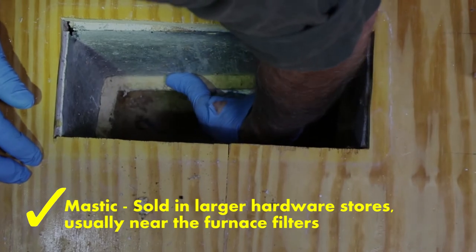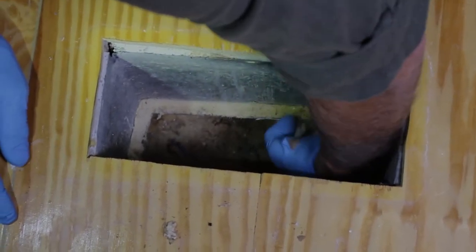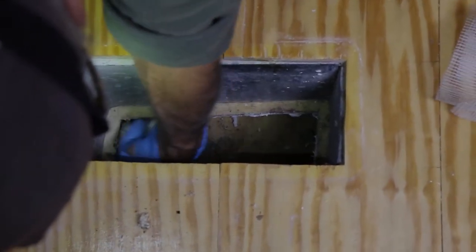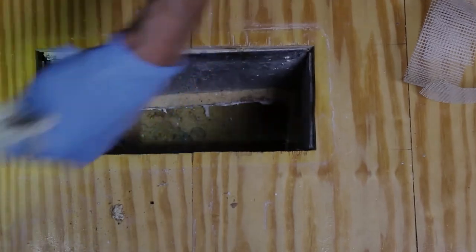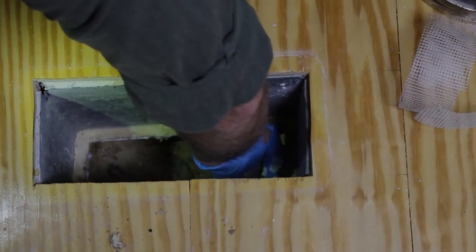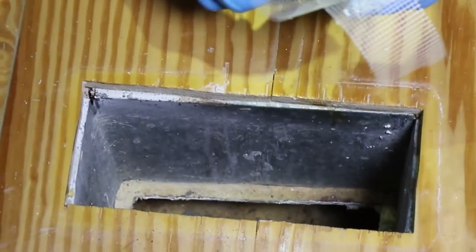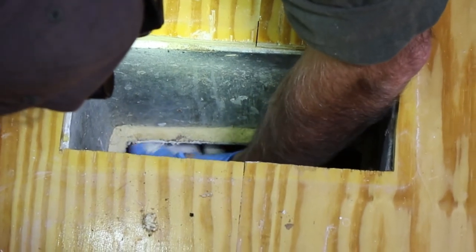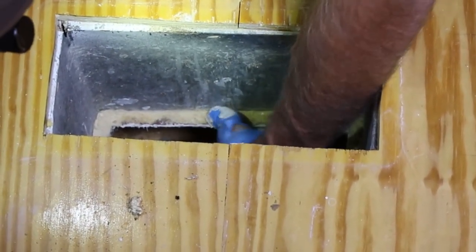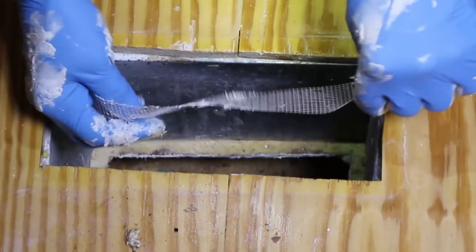I use a thick layer of mastic and I just squeeze that into those gaps and cracks, making sure they get a hundred percent of the area sealed up. I'll go around all four sides doing that, working from one edge to the other. Now you notice I left the mirror in there — the reason I left the mirror in there is I want to be able to take a look at the work as I'm doing it to make sure that all the gaps are actually indeed sealed up. After I put that first coat of mastic in, I will take that mesh tape and press that into that bed of mastic, squeezing it in nice and tight. This just adds another layer of protection, another layer of sealing, helps hold everything together. That mastic will be run from the tabs all the way onto the top of the trunk on all four sides so that we have a nice good bond.